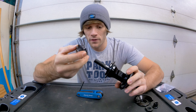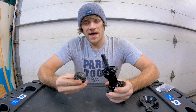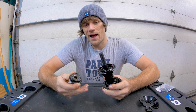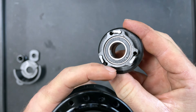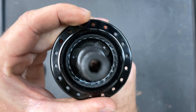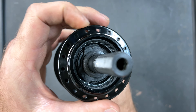I hope that helps explain how this hub is a cassette while moving forward. Now what about the free coaster while moving backward? I said previously that you don't have to disengage this hub — it's the exact same concept as moving forward and lifting the pawls, but in reverse. In cassette mode, all three wedges have lifted the pawls and the hub is moving forward but the wedge piece is staying in place. When the hub goes from rotating forward to rotating backward, this wedge system immediately rotates in the opposite direction.